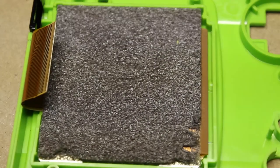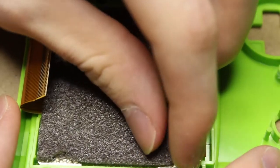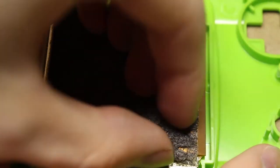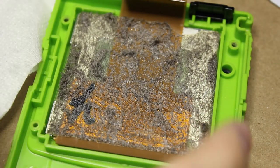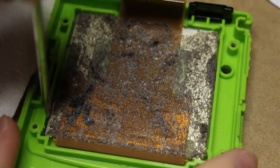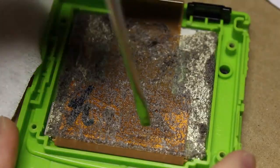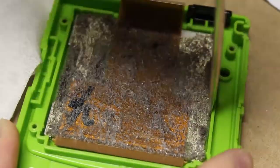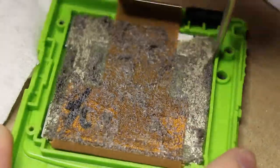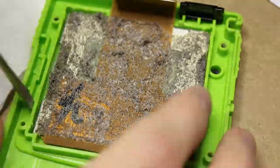On the screen you can see there's a bit of foam here. This is actually too much width to hold both the front light and the screen at the same time, so we're gonna have to manually peel that all off. Now you can see I'm taking a screwdriver and gently prying around the edges. I wouldn't recommend using a flathead screwdriver — use something like a plastic instrument instead. I fast-forwarded because it took a long time to gently pry around those edges. You don't want to scratch anything, and it'll just lift off eventually as the adhesive gives out.